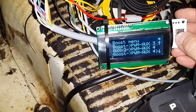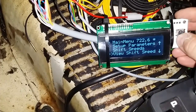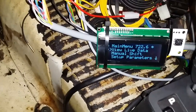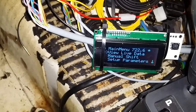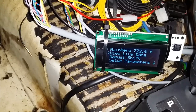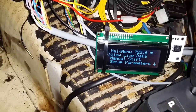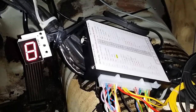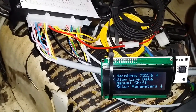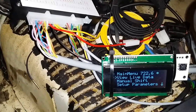The documentation is more than sufficient to get going. It took me a lot more time to rip the old one out than it did to put this unit in. I'm not knocking the PCS TCU 2000 — I think it's a very sophisticated product, I just think it's more sophistication than I need. I need to drive my car. It's just tie-wrapped to the harness now. I've got my little gear selector showing what it's doing, and I'm just really pleased with it. Three-to-four shift is still sloppy, but I think I can configure that and have a good starting point.